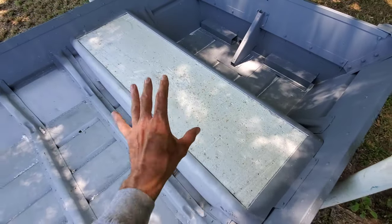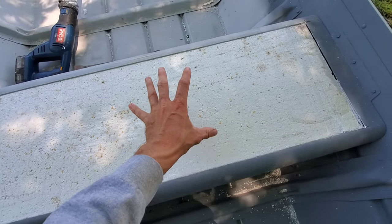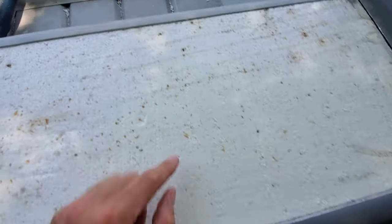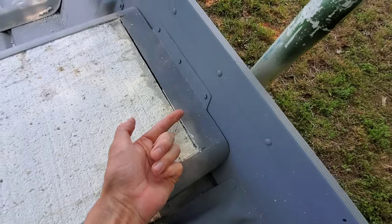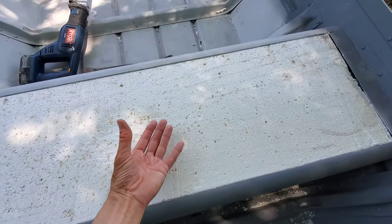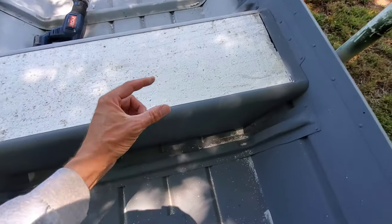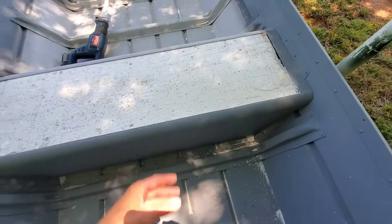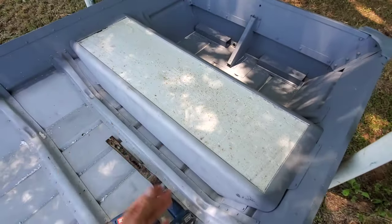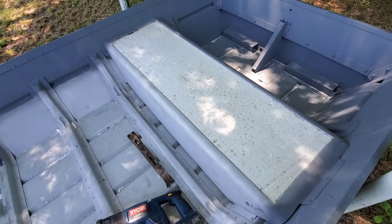In this case, this is one of the rare instances where the foam is actually in good shape. Now when you cut the top on these, a lot of times this foam completely fills the void - meaning it runs under this lip and under that lip. By leaving these lips to tie my framing back into, I can't pull the foam out in one piece. If you go all the way to the edge it'll just come right out, but you need to leave something to frame back into - and that's the dilemma. A lot of guys will just come in and start taking this out in chunks with no rhyme or reason and end up with 50 million chunks and foam dust everywhere.